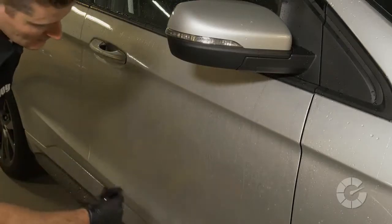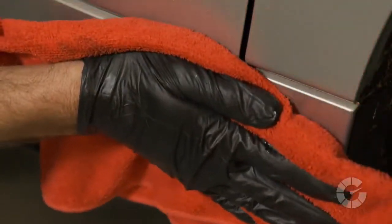As you progress to the lower portions of the paint, the vehicle will have more dirt — or said another way, more tiny rocks — that will require more lubrication to avoid marring the paint. So be sure to splash the area with the remaining one gallon of water and apply a heavy layer of rinseless wash before wiping with several clean and damp microfiber towels.